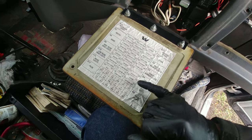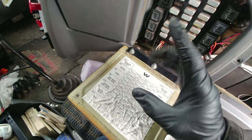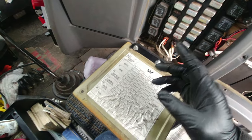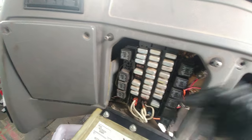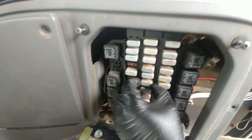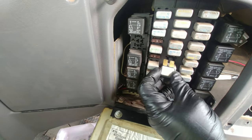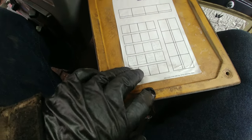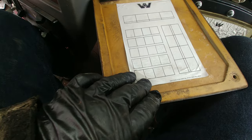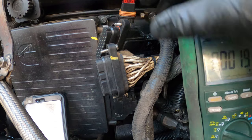There's an optional ignition fuse — 30 amps, F16 — check that. Also the ECU fuse at the ECU itself, located on the driver's side of the engine. These style fuses you cannot see if they're good or not, so just pull it out and check continuity. Also check fuse F33, five amps — check that one as well.